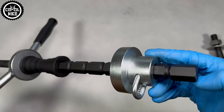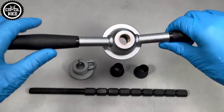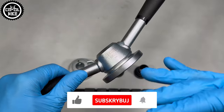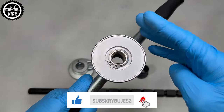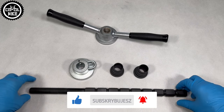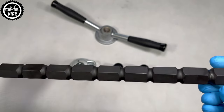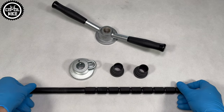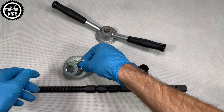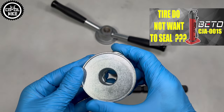Their press has a very simple design and it's practically identical to the more famous Park Tool. It consists of a squeezing rotary handle, spindle, and most importantly a clamping sleeve with a lock and two conical bushings holding the headset cap.